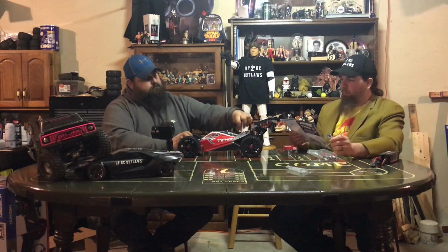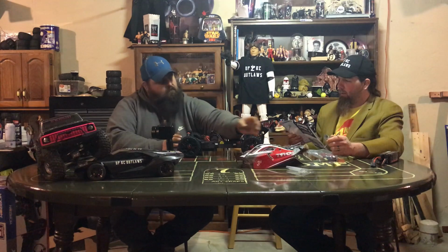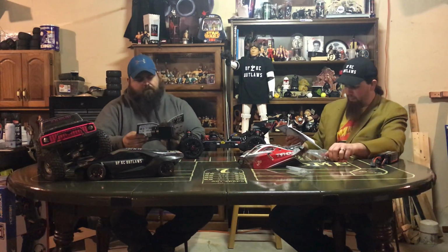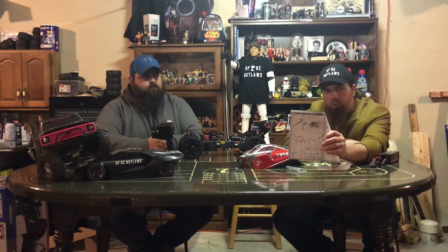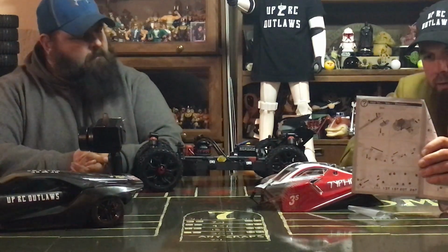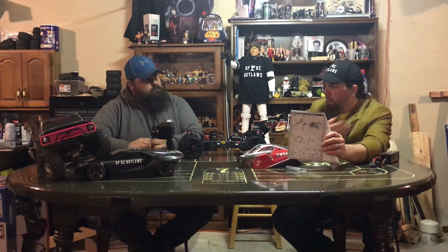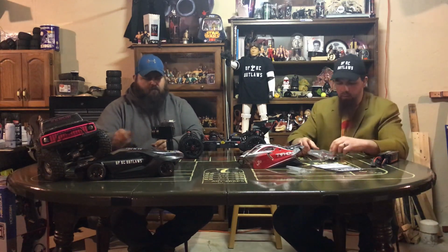I have to admit, on a lot of the four-wheel drive stuff, I'm not a fan of the way stuff meshes, though it seems like everything's going that way. Yeah, they do have a weird mesh system. For your 13, 15, 20, 26 tooth gears, there's just a little thing on the actual mount that you move the screw over to, and that should be your exact mesh point. I'm still a fan of sliding a motor around to move into the mesh point. You can get a little more exact with what you want to run. Yeah, it's not just Arrma, every company seems to be doing it.